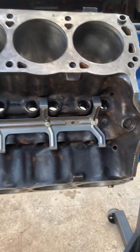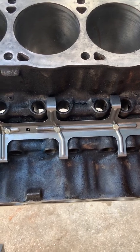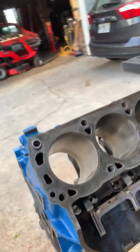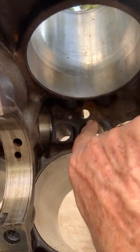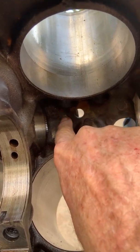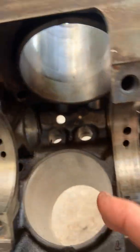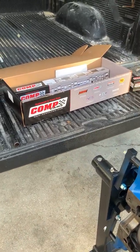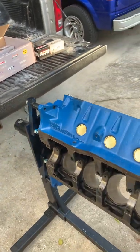I was careful to stand the rail off above the drain hole since there was no boss — I spaced it up with stacked flat washers and through-bolted it. I made sure the fasteners didn't come through. You can see the bottom of my bolt is flush with the top of the casting at each location, so there's no interference with the cam lobe or anything. That's how I'm making this kit work. I'll let you know how it turns out, but I've been on the forums and saw some problems, so I felt posting this up might be helpful to anyone else using this kit or doing this build.